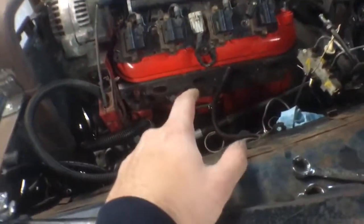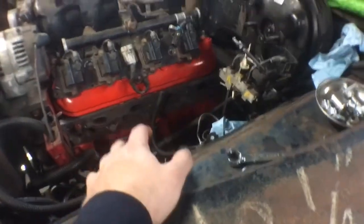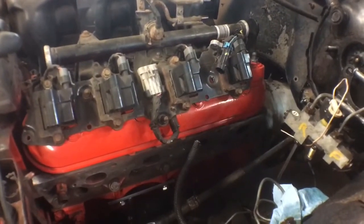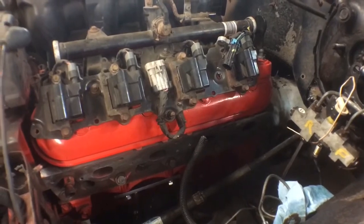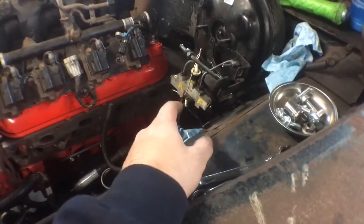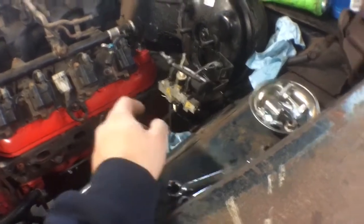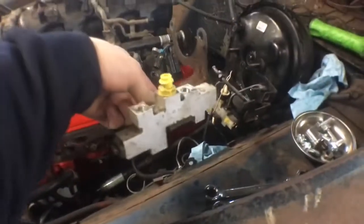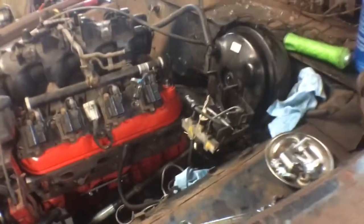I started working on an exhaust. I don't have any other pieces, so I started trimming the manifold. My plan was getting too close to the master cylinder and it wasn't working too good. So I was going to try a different master cylinder after I swapped proportioning valves, because I still can't get fluid to the back of it. Plus, this proportioning valve needs to turn. This one actually sits the other direction, so I'm probably going to end up using this one. Hopefully it works — if not, it's getting eliminated and I'm just going to run it right off the master.